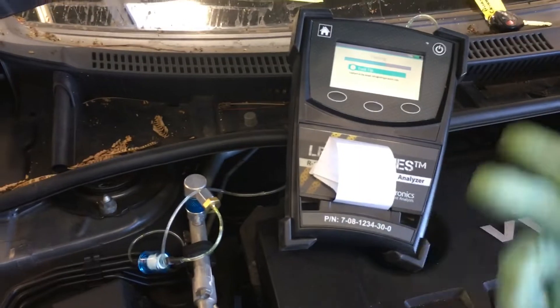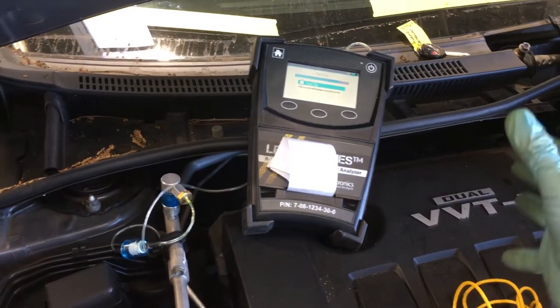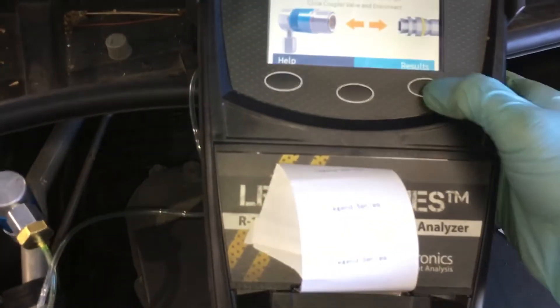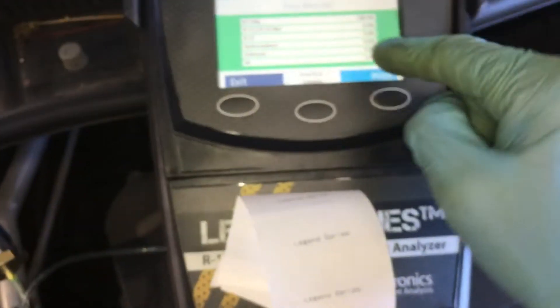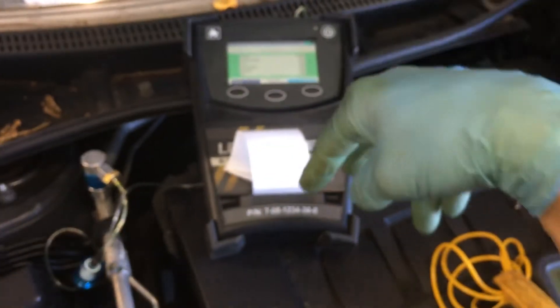We're still testing — you can see this takes time; it's not instant. As the shop, you need to get paid for this procedure, either by adding the time to your invoicing or by raising your labor rate or air conditioning service price to compensate for the extra three thousand dollars for this tool and the technician's labor hours every time this procedure is performed on every car. Looking at the results: we have 100% R134a refrigerant, with three percent air mixed in, but we have a 100% return — so this is good to go for recovery into your recycling container. I'll take a snapshot of this result, and it goes on the invoice — every vehicle I do gets a snapshot of the refrigerant quality I've tested.